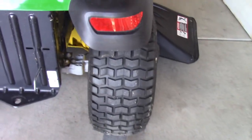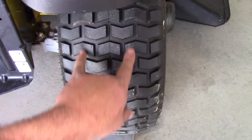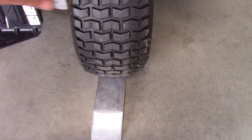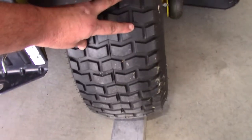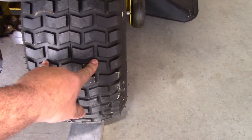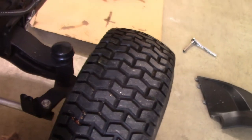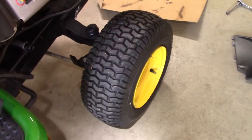Another tip: you can tell when there's too much air pressure in these tires because only the center of the tread is touching the concrete. Do a little chalk line on the ground and track your mower over it — it'll give you a real pattern of how your tread is actually contacting the ground. I've got 15 PSI in here so I'm going to drop it down to 12, which should give me the full width I need. Don't forget to check your tire pressure when you're doing your tune-ups.